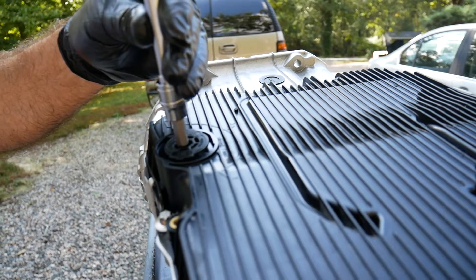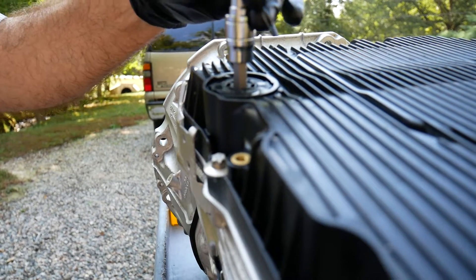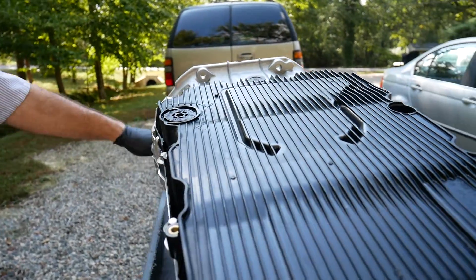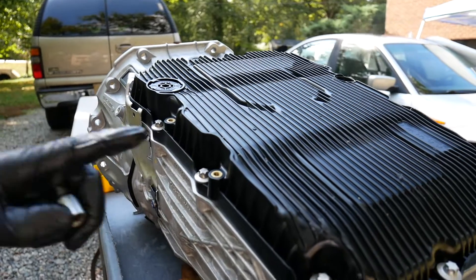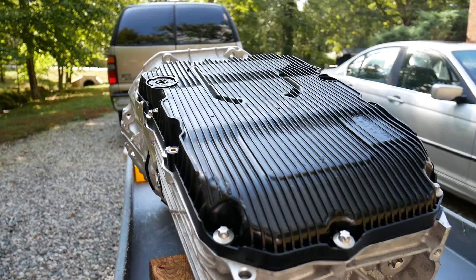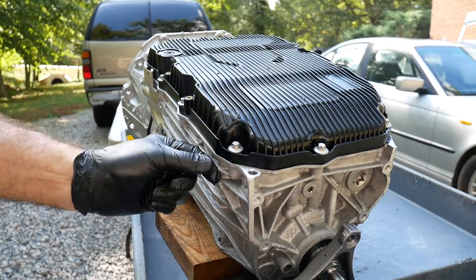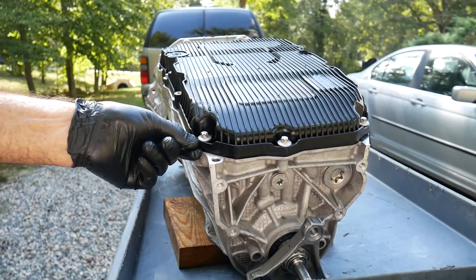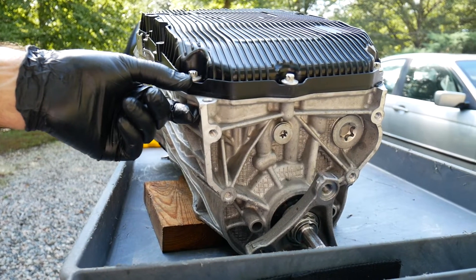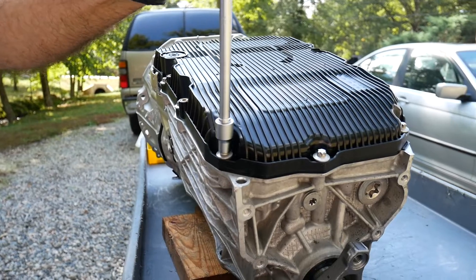When replacing the plug, since this is plastic, it's just barely hand tight — you can feel it move against the stop. The seal is the O-ring. When purchasing filters and a pan with a gasket, the plug and standpipes come with it. Removing the aluminum bolt fasteners for the pan, there's actually a steel sleeve that defines the torque imposed on the rubber gasket, so this is simply seated. Since this is aluminum, torque is measured in inch-pounds.